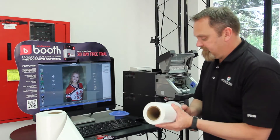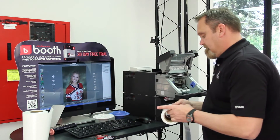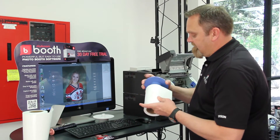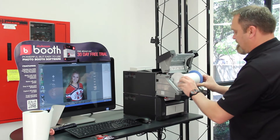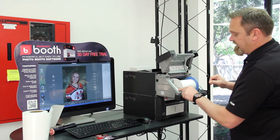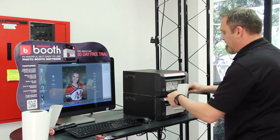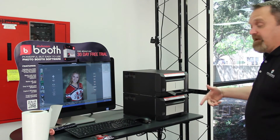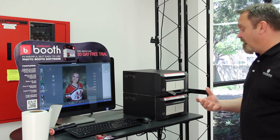Take these end caps off and replace it with non-sticker media. Remember when you're loading this printer you're going to want the blue on the right hand side. Drop it in there and turn it until the paper set light comes on. Close that, shut the printer, and put your tray back on. Now give it a second to spit out — I think it'll spit out four sheets, which takes care of any fingerprints you might get on the paper while loading it.